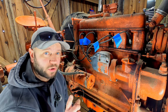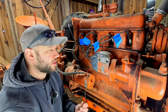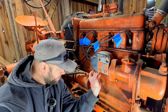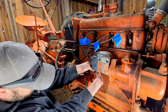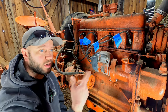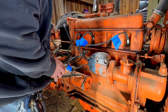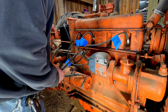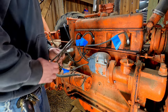Now there's one more thing I want to test before I start hooking the rest of the fuel system up: I want to hook up the engine kill switch and make sure it's working and kills the spark. This just attaches to the case of the magneto. I'll pull a plug, hit the button to make sure we've got spark, flip the switch, and make sure the spark's not there. Okay — we got spark with the switch off, so that switch is not working.